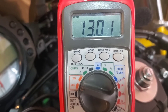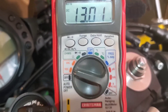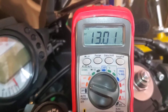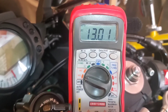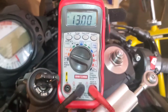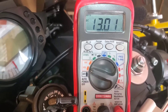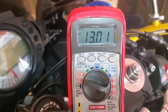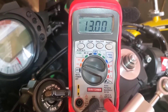That's great — it's a 12-volt system, but that doesn't mean we're gonna get 12 volts. It means we better get at least 12; 12 is really dead at that point. We need to be closer to 13. Check your owner's manual — I believe Kawasaki says 12.8 is about perfect for these. Regardless, we're going to check it at DC voltage and switch on the battery.